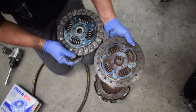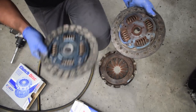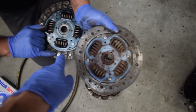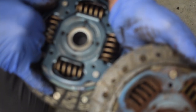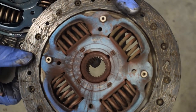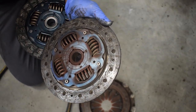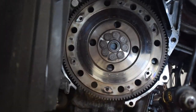Right, so how can you tell this is the old one that's just come off and this is the brand new one going on? On the old one the springs are loose. But if you look in here at the rivets — they've got grooves where the rivets are. Look at the depth of the clutch plate — the rivets are nearly touching it, it's nearly gone. If you did a track day with that it would want a flywheel because you would have damaged the flywheel. So very very close — it's a good job that Area Motorsport pointed it out to be fair.